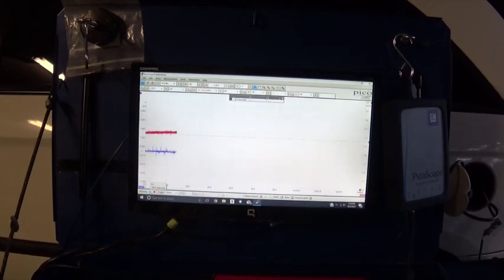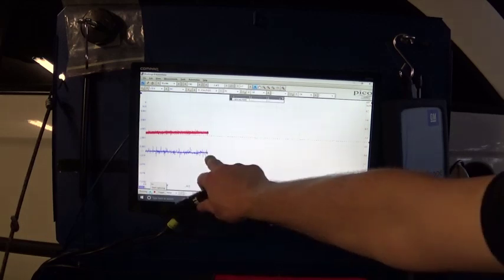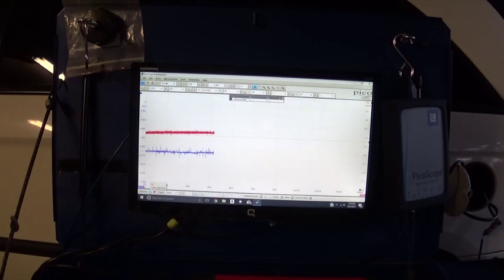So the next one I'm going to do, I'm going to take a smoke machine. I'm going to leave my vent hose pinched, and I'm going to use the smoke machine at the filler neck. Now we can see it's going to open pretty soon. Definitely a leak, and it seems like a large leak actually. Now the switch is open. We cannot hold the vacuum. Let me just show you guys what I've done here underneath the car. As I said, I just pinched my vent hose, and right there, that's my vent hose. I got it pinched. So I have to do this.